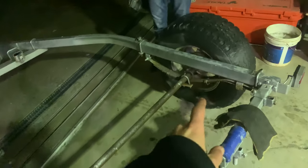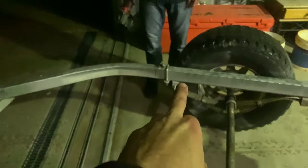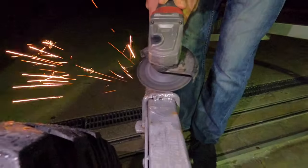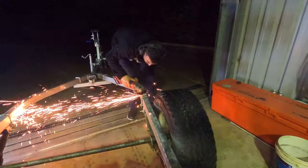Now we're in the shed - the rain was just too much. The bearings are done, tires are bolted back on. Now we're grinding off all the imperfections on top here where the previous owner had welded the mud guards on, getting Will to grind those back down and remove all the surface rust. Those U-bolts where Will is grinding have seen better days - they're pretty crucial as they hold the frame of the axle to the chassis of the trailer, so these will definitely be replaced.